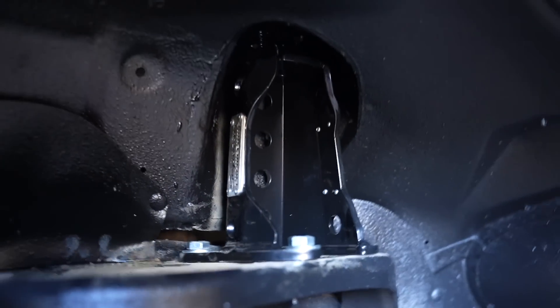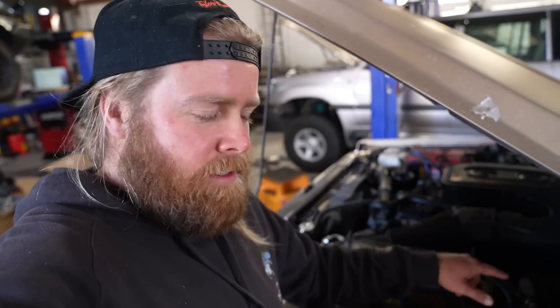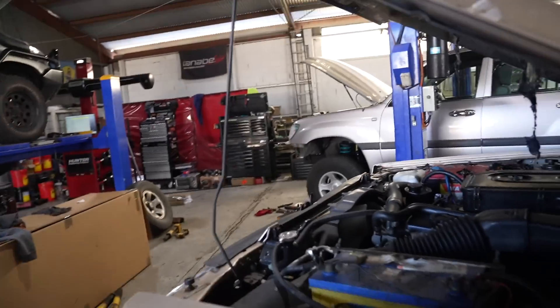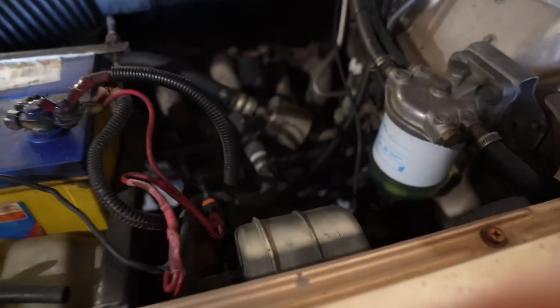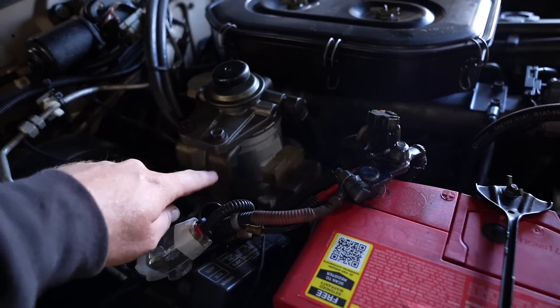The issue is there's no room there. Once that shock goes in you can't actually do it up. Which means in the engine bay you have to hole saw a hole above that shock tower and that shock tower over there. When we did this on the GU it wasn't too bad — pretty much directed there, just put a little hole saw, paint it up, patch it up, bolt your shock up, good to go. But with this GQ you've got a bit of stuff in the way. Over this side the fuel filter is directly above it, and the fuel filter bolts into where we're going to drill out. So it means I have to relocate that fuel filter. I've gone with big long shocks for heaps of flex and travel when you're out four-wheel driving — you can get smaller shocks and avoid all this drama, but I decided to do things the crazy way.